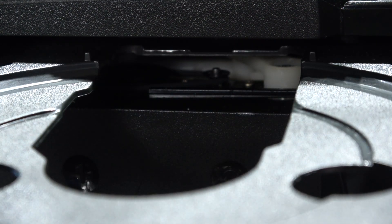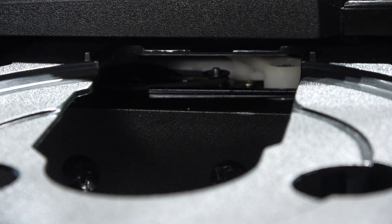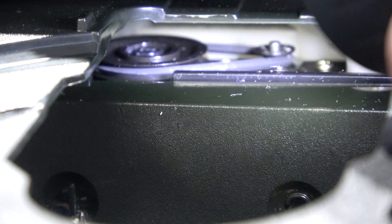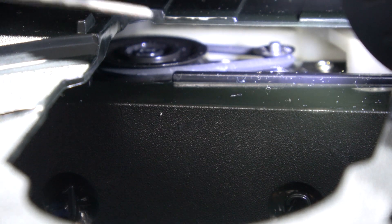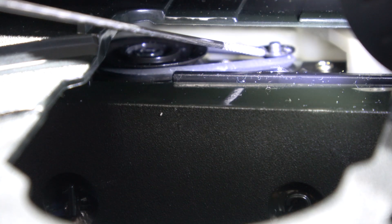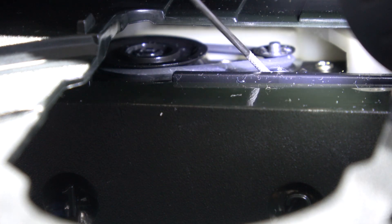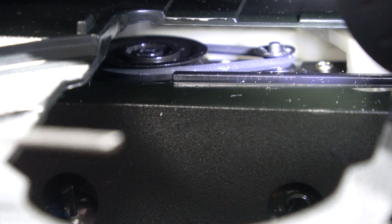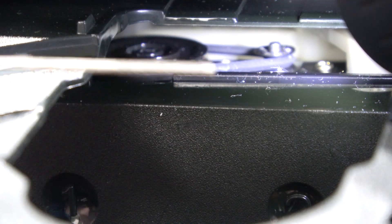And there we go — the drive tray is open. Now I can show you what the problem is. If I power on my torch and look inside, on the right hand side this pulley is connected to a motor just below, and that turns a belt which turns another pulley responsible for opening the tray in and out.